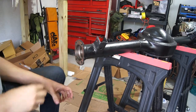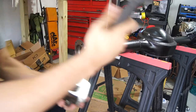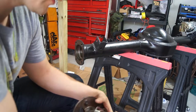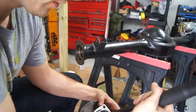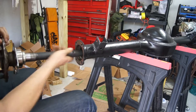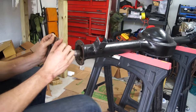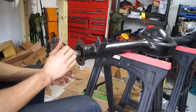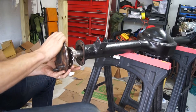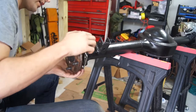First thing I'm going to do is put a little bit of gear oil on this seal so that it's not dry. Then I'll get my axle shaft. My axle shaft had the large bearing already pressed on there and it has the housing flange on it. Then you put your spacer over top of that — I'm using the B spacers. Feed this in there, entice it to go in, move it around and have those teeth catch. That's in.